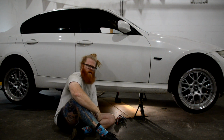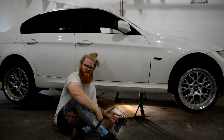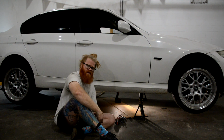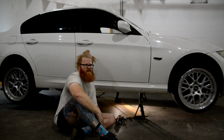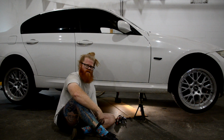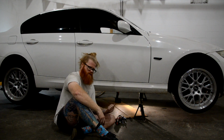So it's got about 20,000 miles on it. Even driving the way that I drive, I would have thought that I would have got more. So maybe the center support bushing failing and letting it flutter like that could have allowed more movement, and that's kind of what caused it to fail. Regardless of the whys, I do have a new guibo that we're going to throw on here.